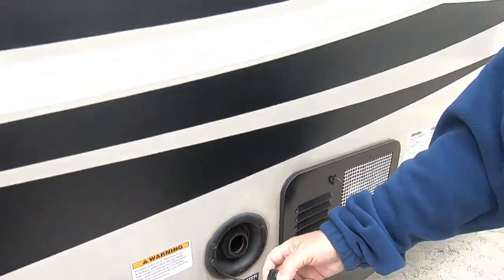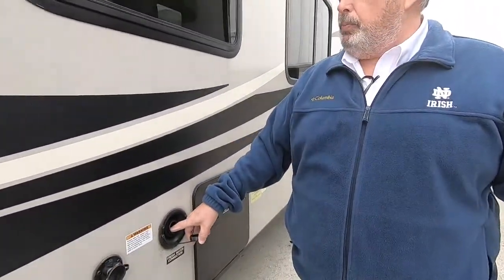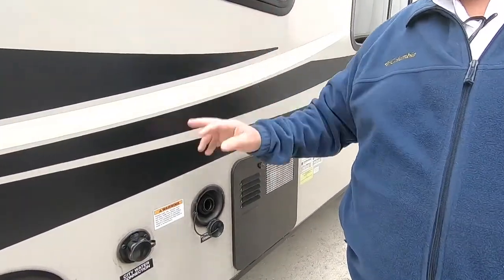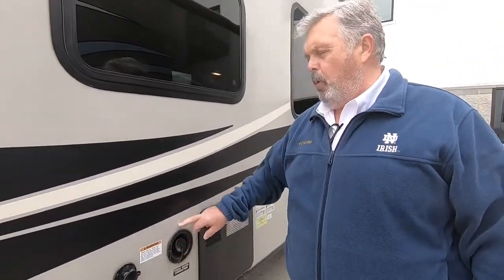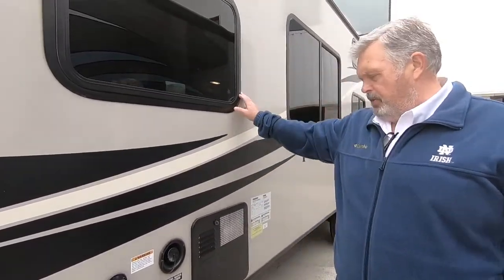Your fresh water connection — if you want to carry water and you're going somewhere that does not have water, you need to put water in your holding tank. This probably holds 35-40 gallons of water. When you use this water, there's a pump button on the inside — I'll show you when we go inside. That pump button, when activated, will pump the water out of here to everything on the inside. Do not turn the pump button on if you're using your pressure from the hose. This is your holding tank and it requires the pump on the inside.